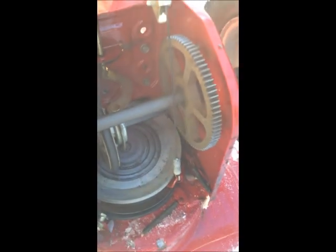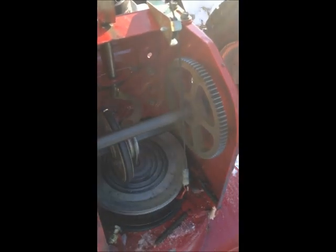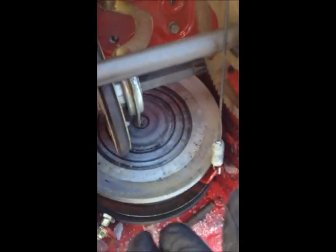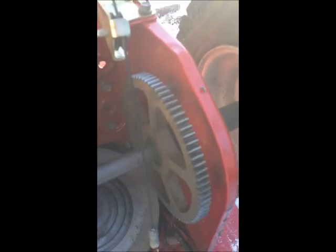The reason I couldn't figure out what was going on is because when I got the wheels back on and put it back in place, you can't see that there's any slot or any kind of key missing. So I'm not even looking for anything like that — a pin or anything. Everything is spinning: the flywheel, the pressure plate, and so on. If you put the wheels on without realizing it, there's nowhere to see where that pin goes — it's covered by the sleeve.